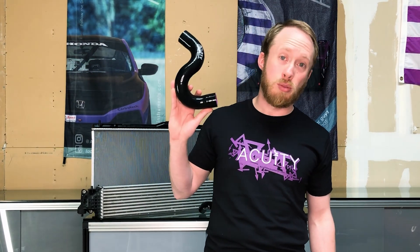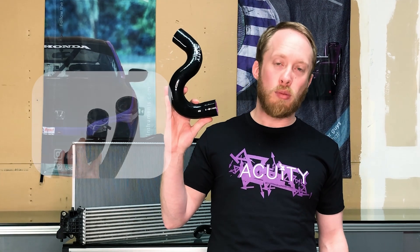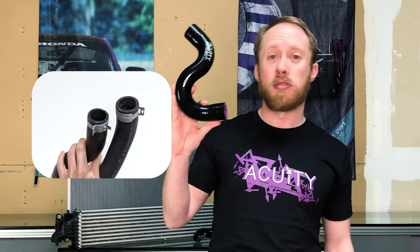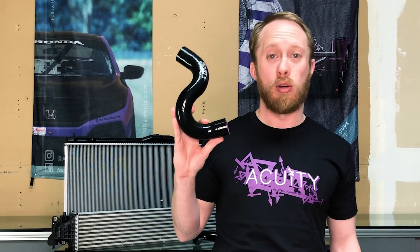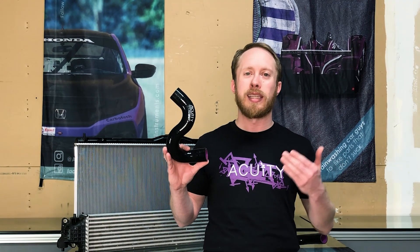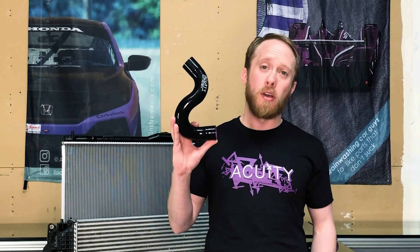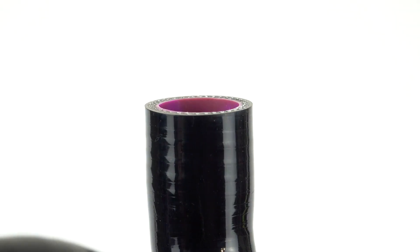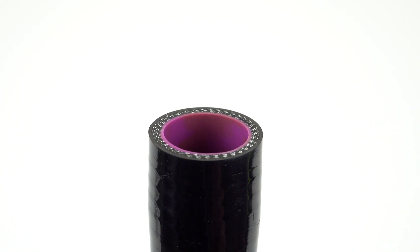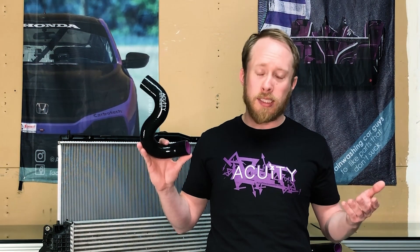I want to talk about another feature on these radiator hoses that makes them beneficial for performance applications. Most street cars use EPDM rubber with fiber reinforcements on their radiator hoses, and the FK8 also uses that construction on their charge air hoses. EPDM rubber is fine for most applications, but when you push the car harder and under-hood temperatures climb, you start to run into the temperature limitations of EPDM rubber — it can degrade and cause premature failures, whether leaks, bursting, or similar issues. Silicone can handle about 100 degrees Fahrenheit higher temperatures consistently than EPDM, giving you more peace of mind in performance applications or when ambient temperatures are very high.